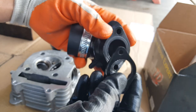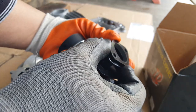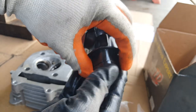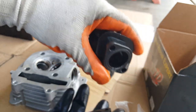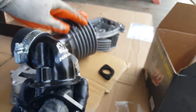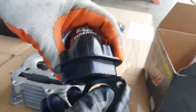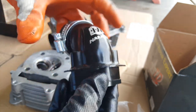So this is what we're going to deal with — the intake manifold of the 232. That way it flushes perfectly. There's no extra plastic blocking the wind from funneling into your bore and cylinder head. So this is great. We're going to use this one. The only purpose of me putting a plastic spacer and not having the manifold go straight in there like I did before — I want to see if I can compensate and not have this heat up to the same temperature as when the cylinder head gets hot.